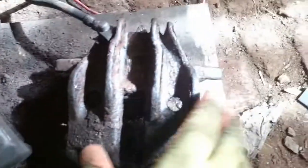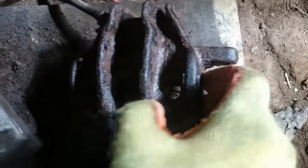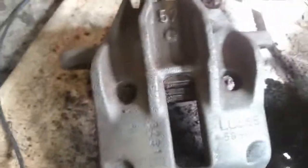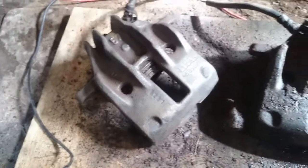I've had to chip away at some bits of rust, however you can see the difference. This has just come out and you can see it wants to flake away already, like soft icing. I've just given that a quick rub down, and you can see that would take a long time with a wire brush compared to just leaving it in there overnight. It still needs a bit more rubbing down - I'll probably get a wire wheel on a drill to finish it off, clean it with some brake cleaner, degrease, and stick some Hammerite on it.